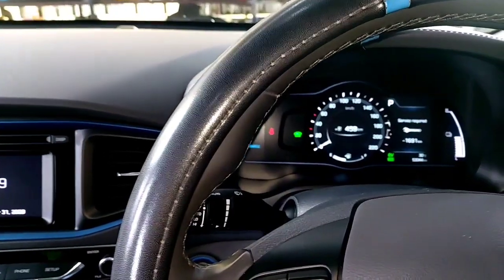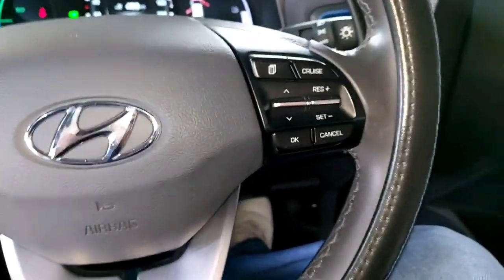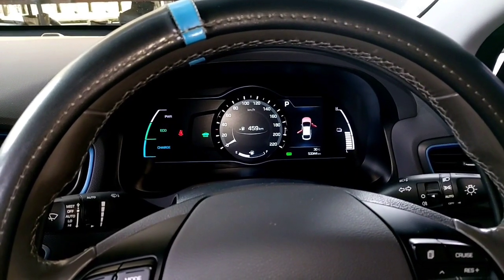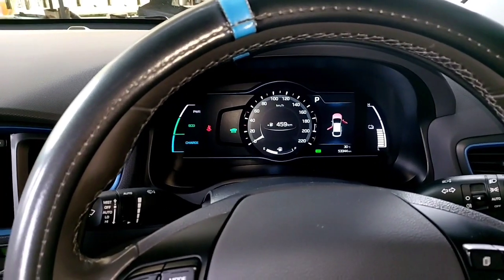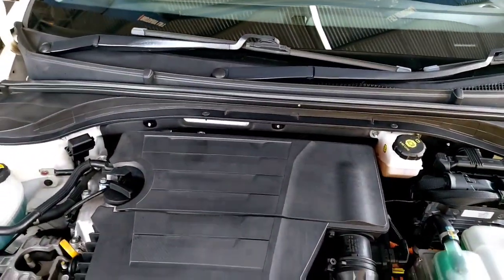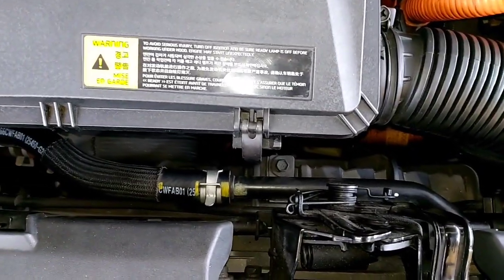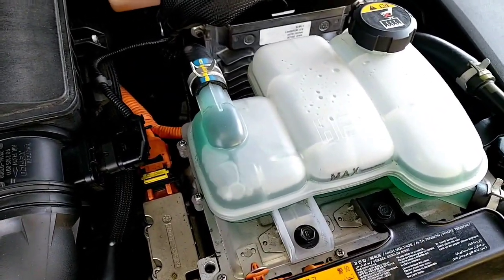We're not listening to the engine because this is a hybrid — we just start and we can do it manually by just accelerating. We've finished servicing the high voltage battery cooling fan. The vehicle is on right now. You can hear the air conditioning and radiator fan — the inverter's cooling system is working.